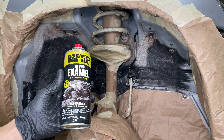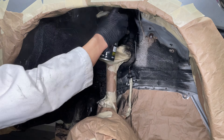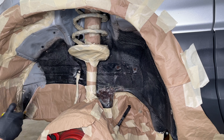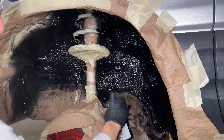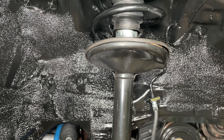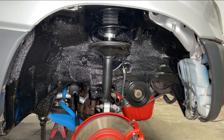I have high hopes for this Raptor Pro enamel paint. I've painted a couple small things with it and this paint goes on smooth and doesn't seem fragile like that crappy rust-oleum. The can says spray one to two coats three to five minutes apart then let it dry for 60 minutes, and it's five times stronger than other paint. Fresh black fender wells go a long way to make your car look better. This paint dried extremely fast as promised and looks amazing. I masked off the struts because removing them would require paying for an alignment again. This paint has a very smooth and slippery finish — I think dirt won't stick to it. That's awesome.